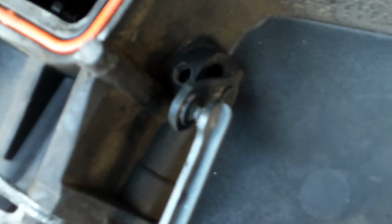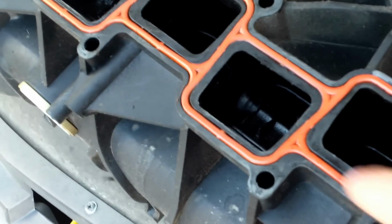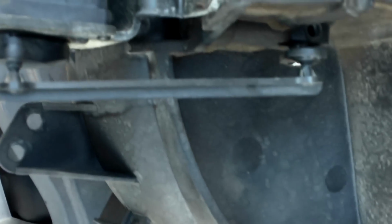And the way that works is the rod itself works really close to the bearing, which should seal, and there should be no air leak through here, because this will be connected to the lower intake, so they'll be sealed by the gasket. And what happens is, as that is unaligned, there is a plastic pin over here which we'll pull out for you guys to see. Right there. That actually holds the rod in place. Like my brother said, that holds the longer rod in place.